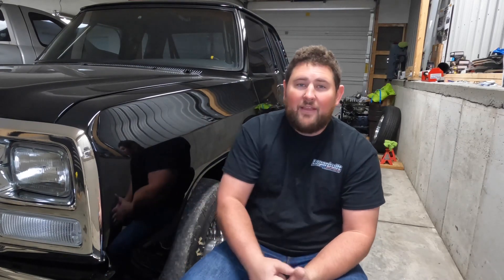It's a lot more challenging to look at it and say, what can save weight and also increase the performance of the truck? Is it going to make it faster, more stable, more consistent? I challenge all of you to go through your trucks and find everything that will check more boxes than just weight savings. Once you start really thinking about it, you'll find more things than you thought — it'll take more time and money than you think. Once you've handled all of that, then you can pick away at the simpler stuff: a carbon nitrous bottle, a smaller fuel cell, fiberglass doors, fiberglass bedside, fiberglass front clip. Do all of that after you've done the things that give you more gain.